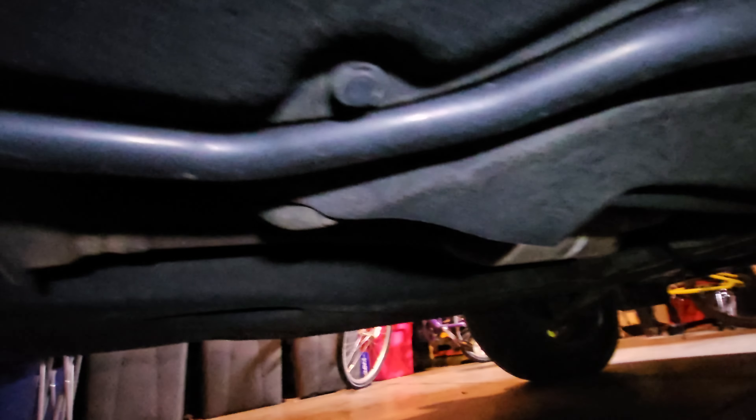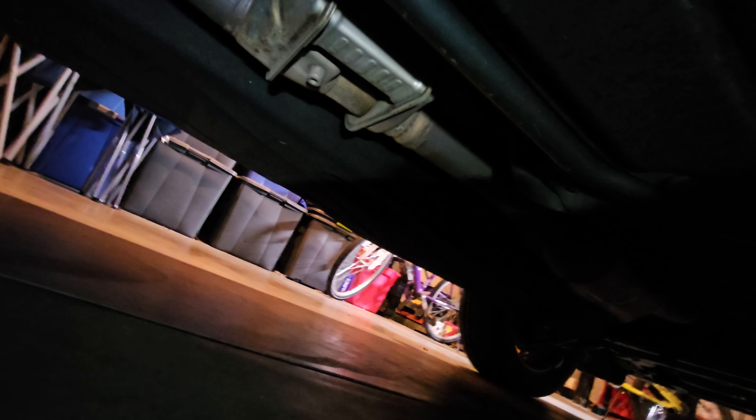This exhaust has been replaced once already. Looking underneath the rest of the truck, you can see the catalytic converter — that looks pretty good — there's another cat up front which we'll look at. There's really no rust outside the exhaust system underneath, and even then that is all just surface rust with nothing component-wise affected. All of where the high voltage battery lives is covered up nicely, and the rocker panels are all in good shape.